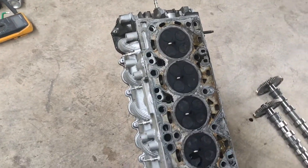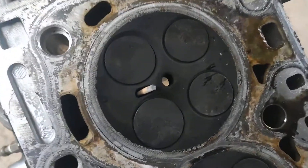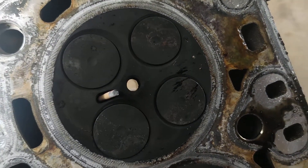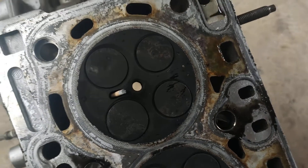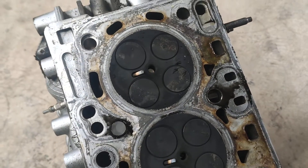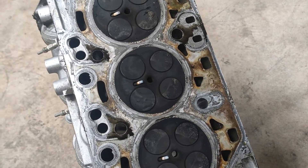Here's the head. No marks on the actual valves themselves, but it impacted and smashed the head. That head casting is really weak, but I'm guessing it's sacrificial to try and save the pistons when this happens - the minimum amount of material to do the job.